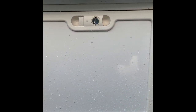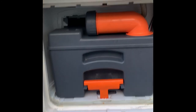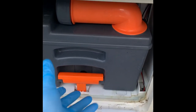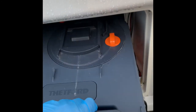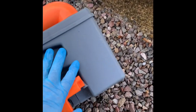Underneath that, this is where the toilet cassette is located. It's the standard Thetford, and when it's full the light will come on by that on the toilet. Just go in here, lift the orange handle and pull it back towards you, and then you can lift the cassette out. It does have a handle that will come up.